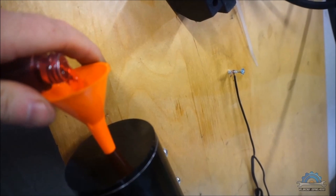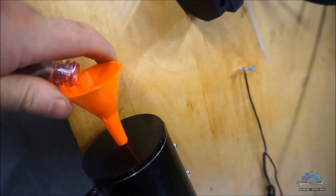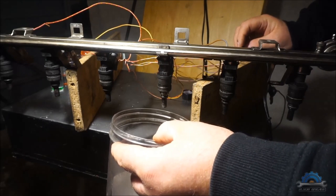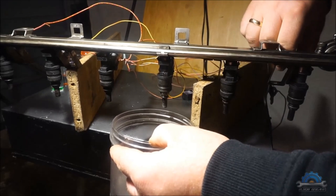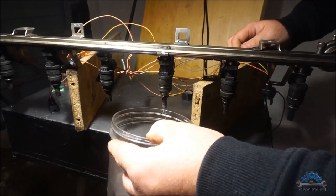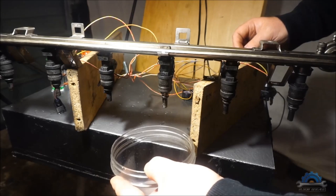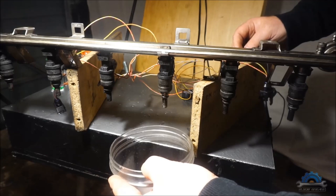And this time I will use it only on injector number 3. Okay, the pressure is set, injector number 3, another dose of half and half fuel and injector cleaner. Oops, needs to disconnect the others, just one. There will be some water first, but later the proper stuff should come out. You can clearly see that this pattern is okay, but it just sprays tiny lines, not like the other ones, more like mist. This one is just not efficient enough.